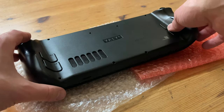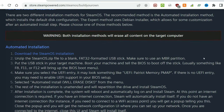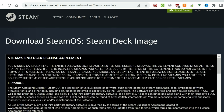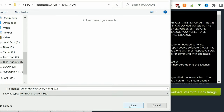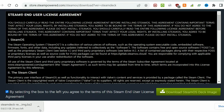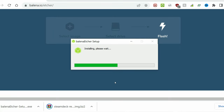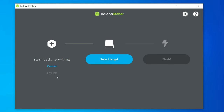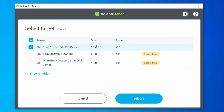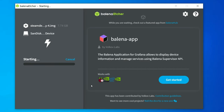Now we can finally put it back together. We now need to download SteamOS — the link is in the description below. On the website, click the relevant option. If you're happy with the selected version, click the box and then download the Deck Image. Save this to any place on your computer, then download Balena Etcher — just click the green button and follow the prompts. Once Etcher is installed, insert the 8GB USB stick or microSD. Flash this file, select the SteamOS Deck Image, select the USB stick or microSD as the target, then select it at the bottom right. Click Flash, and if a prompt pops up, press Yes. You'll then need to wait for the computer to write the image — it may take 5 to 15 minutes depending on the speed of your target medium.